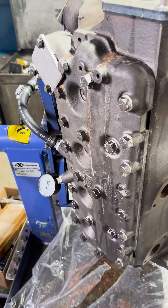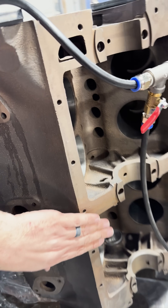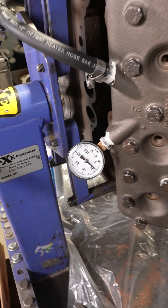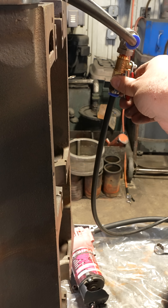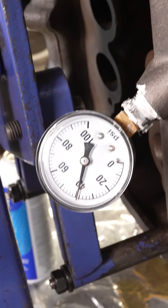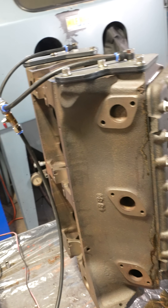We're hoping that the plumbing we've set up will keep the mixture moving throughout the entire engine cooling system and circulating back to the ultrasonic tank. With the small return line we're using, the pump already pressurizes the block to over 15 psi, which is probably more than this vehicle's cooling system runs. By slightly closing the ball valve on the return, we can bring the pressure up to about 40 psi, which combined with the heat should really push the ceramic sealer into any imperfections or cracks in the block.